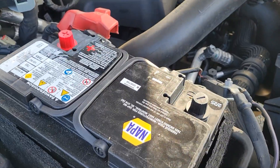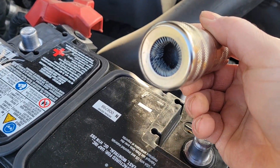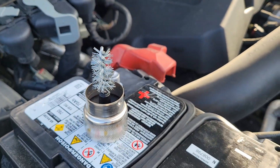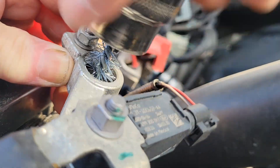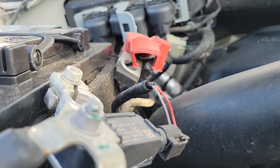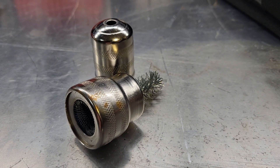If you have a battery blanket like this one, take it off the old battery and put it on your new one. Lift the new battery up and put it in the truck. Once it's in place, remove the protective caps and give both new terminals a quick brush with the terminal cleaner — on the inside you have wire brushes that work well for the posts. Also clean your cable connections on the vehicle — the negative and positive — these ones are actually in pretty good shape.